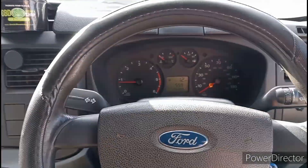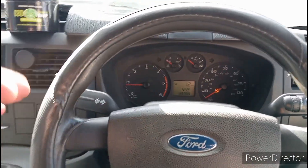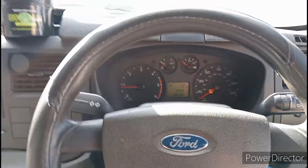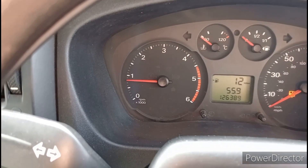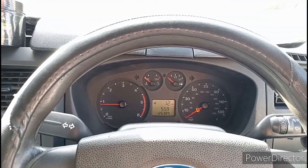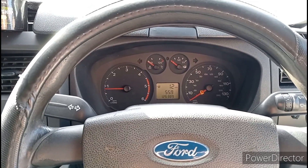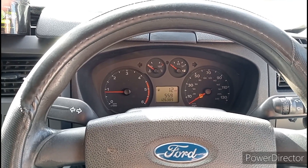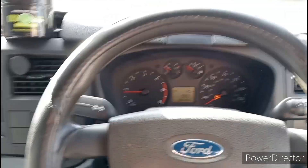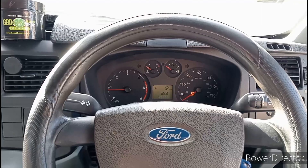If you haven't got the money, just temporarily get your light off and get through your MOT. When you've got a bit more money, go for your EGR valve. It hasn't affected this van in any way — it hasn't gone into limp mode, hasn't lost power, just runs a little bit rough on standstill and the needle goes up and down slightly. So I'm not going to change it till after Christmas. Anyway, thanks for watching — I've been Jay, Beast Reviews. Thumbs up, subscribe, notifications, and any comments — see you in the next video, peace out.